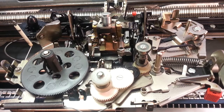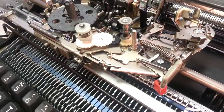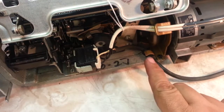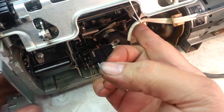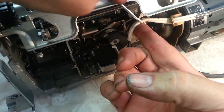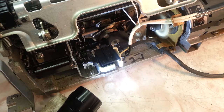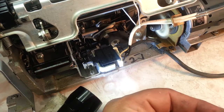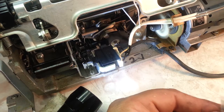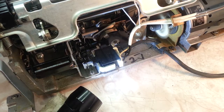You can hear that clicking noise — that clicking noise is the motor bushing is expired. We're gonna show you how to change that. That is the motor right down here. Let me see if we can get some light down here. I'm going to show you how to change this. I'll shine the light right on the clutch there — that's the motor clutch, that's the belt, there's a retainer clip. What we're going to replace is this small piece of plastic right here called a bushing. That's going to get replaced. Let's turn this off.